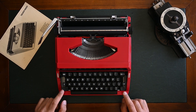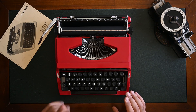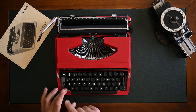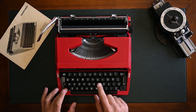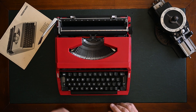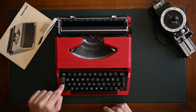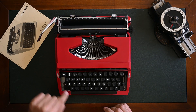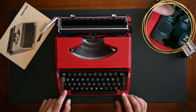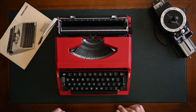Next on the keyboard are the shift keys. There are two shift keys on the Silver Reed — on the left side and the right side — used to type capital letters. To lock capital letters and type continuously in capitals, use the key on the far left side above the shift key, which locks the shift. To unlock the shift, simply press the left-side shift key and it will release the shift lock.